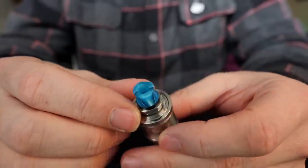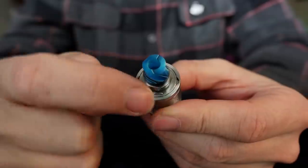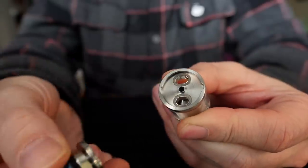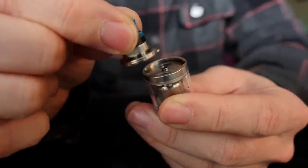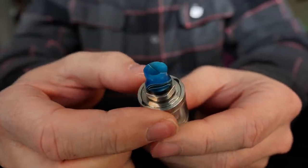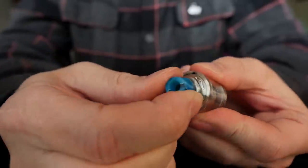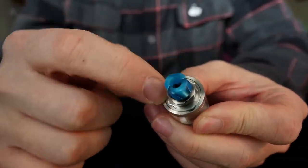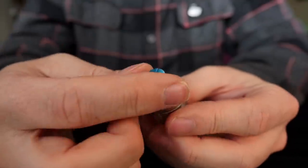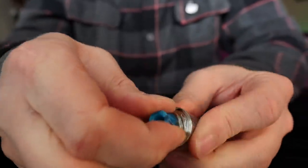Let's tear this down top to bottom. Here's how you refill the juice — you're going to see two notches over here. This whole top plate is just held in with O-rings and pressure, so you kind of twist it until it releases and then take it off to fill it up. Then you line up these notches again and give it about a half twist and it stays insanely secure. When your O-rings are dry this is a little bit of a struggle, but as soon as you have a little moisture on it, it slides and glides really easily.